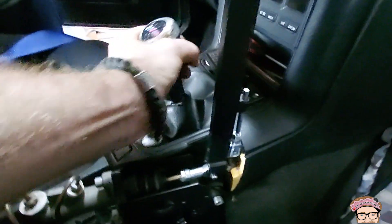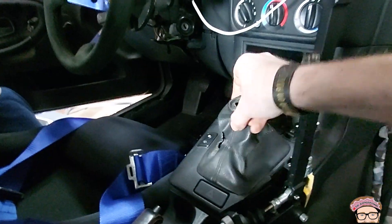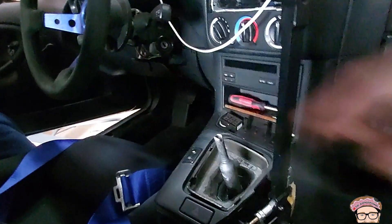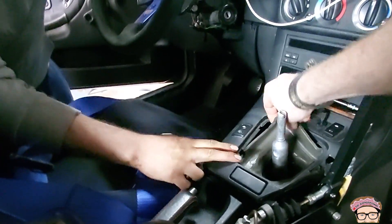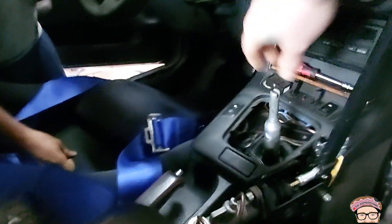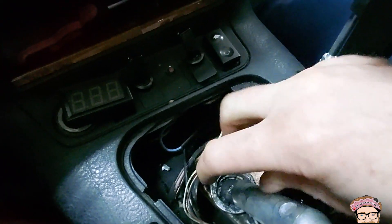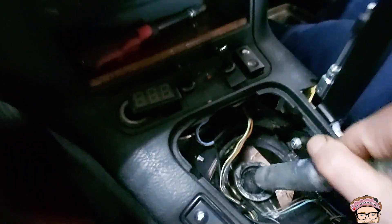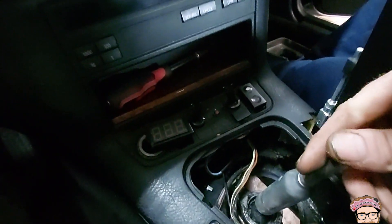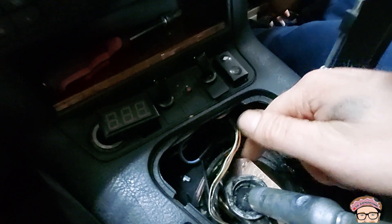Let's strip the top side now. Usually on BMWs — oh, it's even tied on there. Block that one off. This one should come off, and there's a rubber seal that comes out. There's this big rubber one — come on, get out of there. In theory there's a little ring that you can get some pliers on, twist a quarter turn and it comes out — but that never works for me. Since you're replacing this anyway, I just take a screwdriver, put it between the little tabs and give it a tap with a hammer. It breaks off.